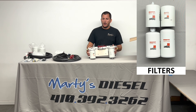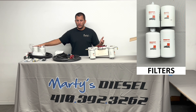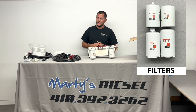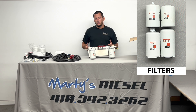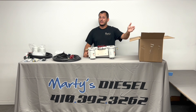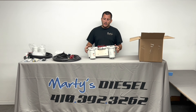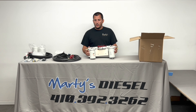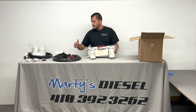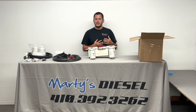Most or all kits currently come out with short filters. If we have longer filters we can send those if you'd like, but generally whatever we have in stock is what we send. We buy thousands of filters at a time and can't always keep up with the demand between long and short from our suppliers — Fleet Guard, Donaldson, or Cat. In the event you don't want short filters, you can put long filters on, or vice versa. They both are better than factory filtration. One is not necessarily better than the other. Personally, I like shorter filters because they don't hang down as low, but some customers want the filters hanging down to show off the kit.